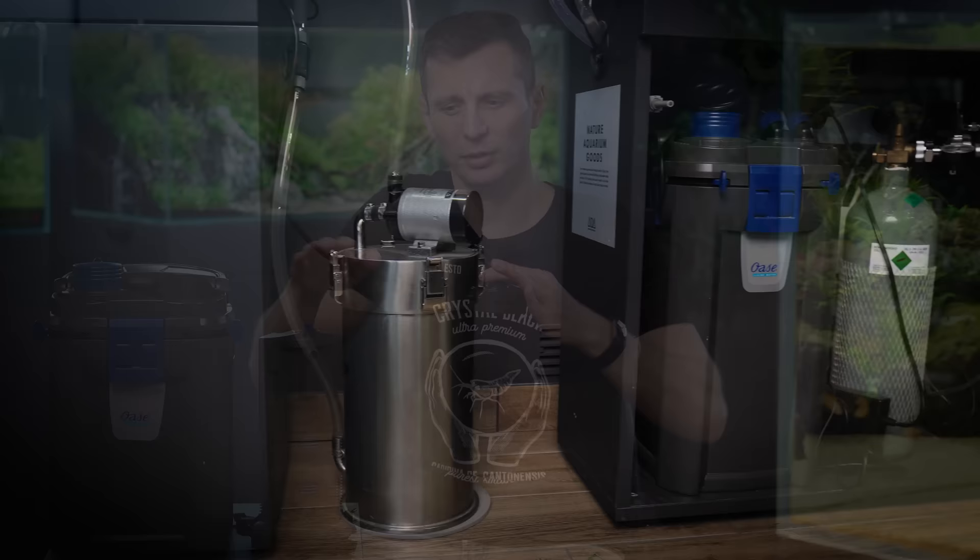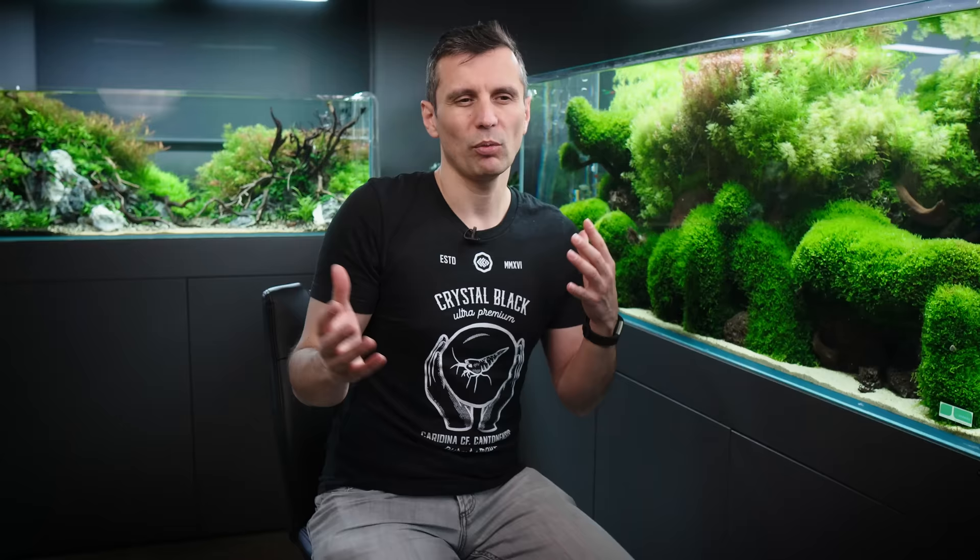This is the hose adapter — where the hoses are coming from the aquarium and going back to the aquarium. You're supposed to keep these filters underneath the aquarium. Never put them right next to the aquarium on the aquarium cabinet, because they need some level difference between them to work. You can remove the filter adapter just by pressing this to unlock position. When you have like a five-fold turnover and a big enough canister and everything is okay with your filtration, you would probably need to clean it every month or every two months or so.